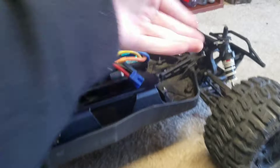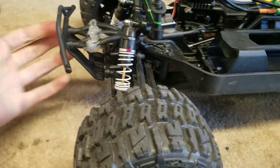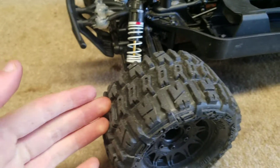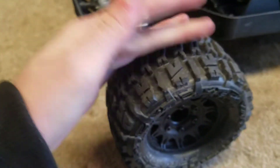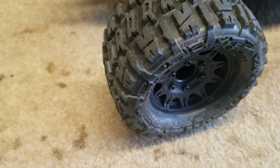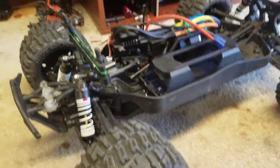So try this idea: if you think you have bent drive shafts, make a little hole in your tires first. If that doesn't work, then you've got something mechanical going on. And if this hasn't happened to you yet — it is March and everything is melting and muddy — just take a couple minutes to hot glue those holes. Put the glue in the hole like I said, because it'll act like a plug. I hope that will be helpful for you guys.